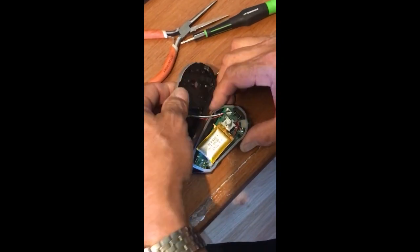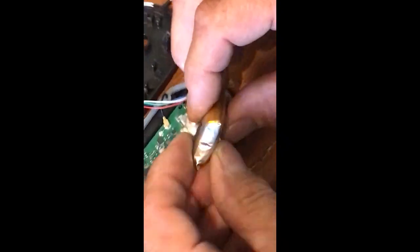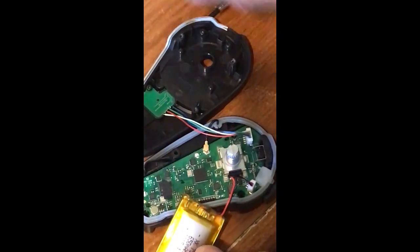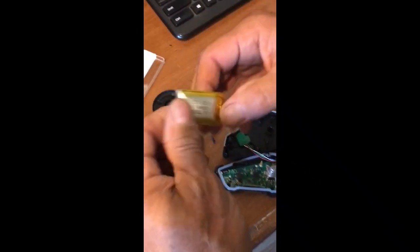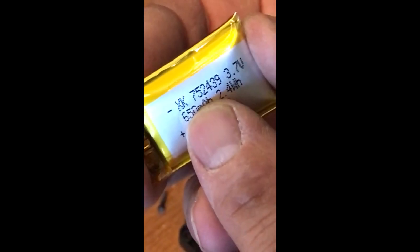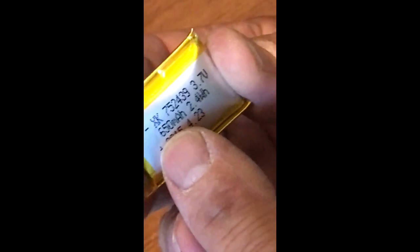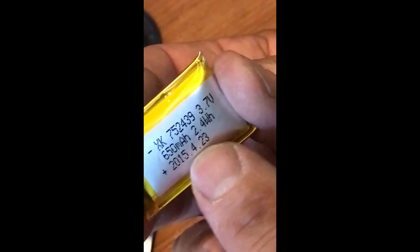I always put the antenna down because it makes it easier. You're going to lift this top off and be careful because these wires are connected. This is the old battery. You see how this battery is all pushed out and bumped out? That's because it's been overcharged. You have to come in here with needle nose pliers and pick that plug out of there. If you look at the numbers on this - it's kind of hard to hang on to when it's all blowed out - the part number for this battery is XK752439.